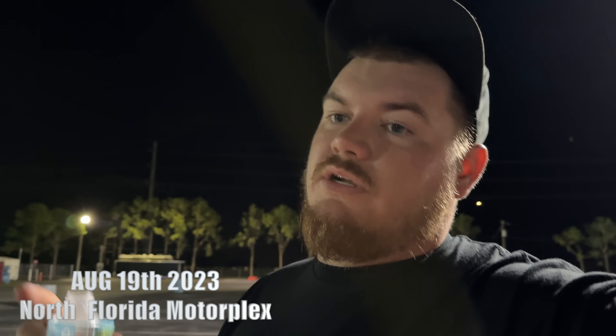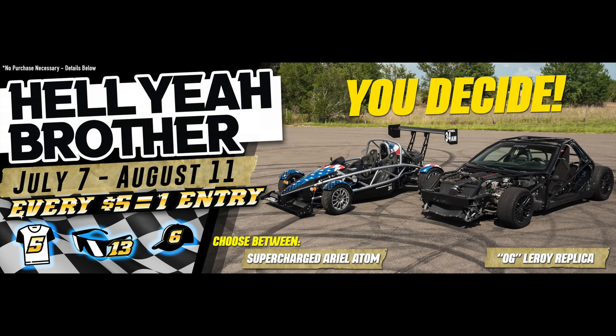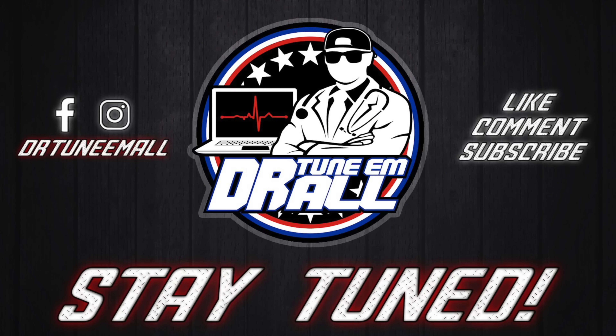All right guys, solid night of testing - I think we had a good handle on the 240. Next race is going to be another stopwatch shootout in North Florida, right around Panama City. If you guys are up in that area, I'll put the dates in one of these videos so if you want to come watch or hang out, you guys can come support everybody. Malibu's giving us a headache - the last time we tried to go testing we had an injector issue. I put a fresh set of injectors in it like you guys saw, dynoed it, everything was good. Came off on the brake, did everything like you're supposed to do, first pass spun but everything was happy. After that, pissed off again - I don't know if it sucked some more trash up into the injector. I'll have to get it back to my shop, pull the injectors out, backfeed them, make sure there's no trash in them, check the fuel system, go back and start from square one again. We got to get this thing figured out because he wants to race FL2K and they're from the Cayman Island - he spends a lot of money and time to come up here, so it's super frustrating for both of us that things don't work. But that's part of racing. I appreciate you guys watching - as always, stay tuned and we'll see you in the next video.